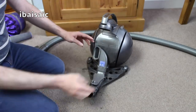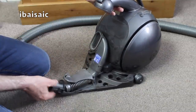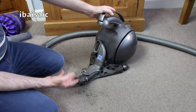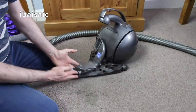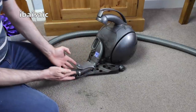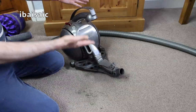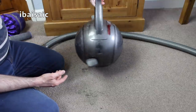If you have a blockage incidentally, when you remove the hose and the bin, this is where it can sometimes block up between this part and the front where the hose goes in. You can put a blunt instrument through there, something flexible to dislodge any dirt. Or again, if you've got another vacuum cleaner to hand, often just putting another vacuum cleaner hose and sucking it out can dislodge anything. This does come apart a little bit more as well — you can take this flexible part off this tube here. That's somewhere that if it does become blocked, that's the first place to check, especially here where it's a bit narrower than the hose. So all I'm going to do with the main machine itself is just really give it a wipe down.